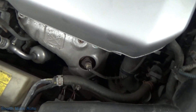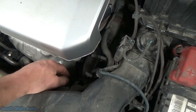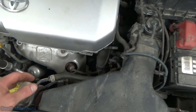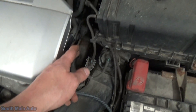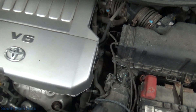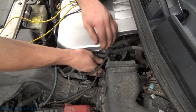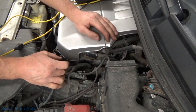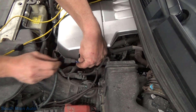Bank 2 is right in the front on this car, so it's the cylinder 2 side. We don't even have to go underneath it, which is awesome. The sensor comes back and is plugged in right here. I'll grab an ohmmeter and check to see if the heater circuit is indeed open. If it is, we'll grab the test light and make sure the heater circuit on the vehicle side works just fine. We don't need a wiring diagram because it's going to be the two wires that are the same color — in this case they're both black.